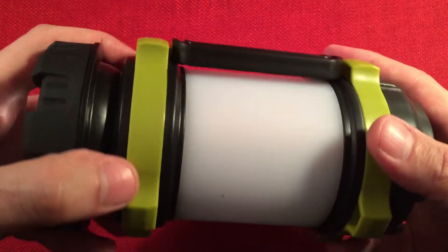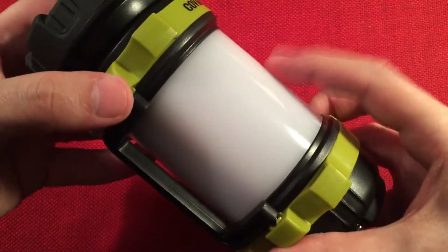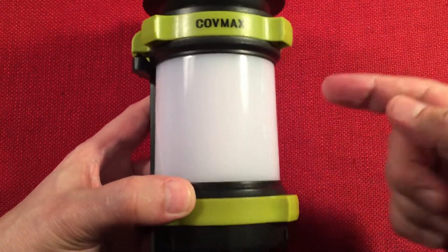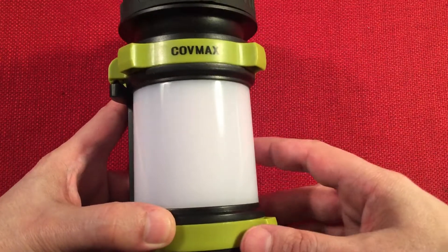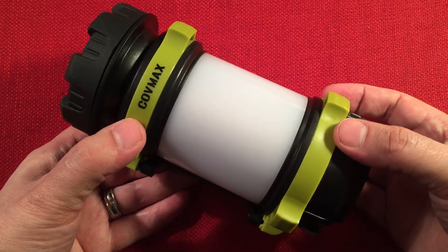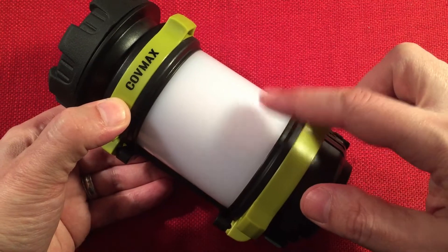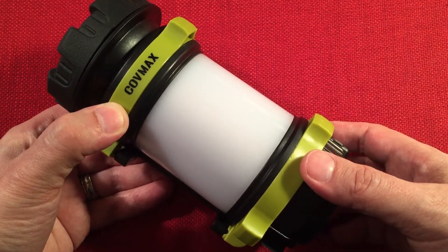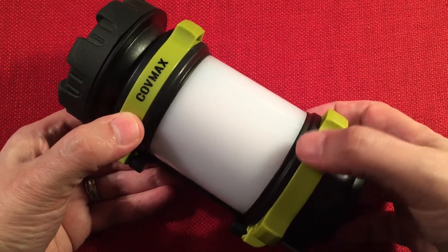We have a folding handle that locks down and out of the way — you heard it snap into place earlier. Behind it are our LEDs and probably our batteries. I say probably because they're not replaceable; the only way to get to them is to unscrew the base, but they're wired in and sealed — pretty much not meant to be replaced, though I'm sure some of you who like to hack on lanterns can figure out a way. Inside there are the 40 SMD LEDs, which combined output about 600 lumens in a cool white at around 6700 Kelvin, plus 20 red LEDs.